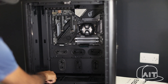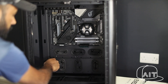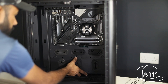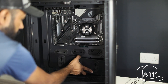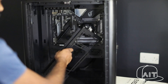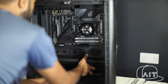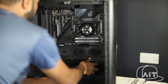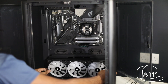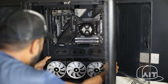Now, let's take off the wire routing backplate and place the radiator plate vertically. I chose this as I wanted to vertically mount the radiator and the RGB fans. Once the radiator and the fans are attached to the radiator plate, place them back in the slot and tighten them with the thumbscrews.